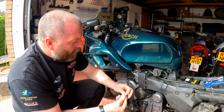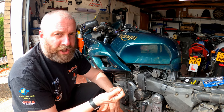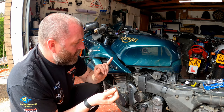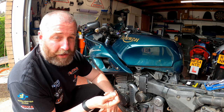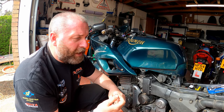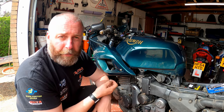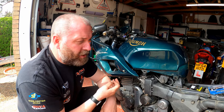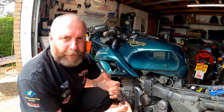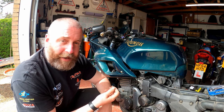Lastly, I want to mention that when I reassembled the carburetors I set them to factory settings. Carburetors one and three were set to two and a quarter turns out from seated — by seated I mean screwed in until they lightly stop, then backed out two and a quarter turns. The carburetor on cylinder two, the middle one, is two turns out. That's the factory setting from the manual. The bike should run at those settings, but over time parts wear and adjustment may be required. I warmed the engine up and it ran okay but was a little lumpy, with a little popping in the exhaust — so I'm expecting at least one cylinder to be running rich.